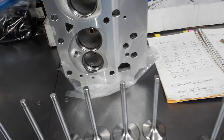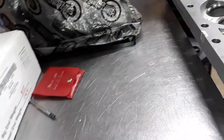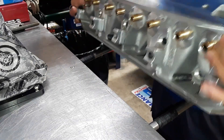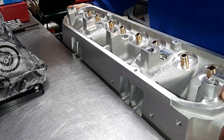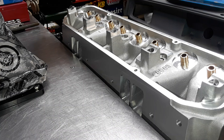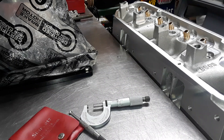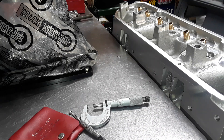The point is: double check everything, measure everything. You cannot assume anything on these engines or any of these parts. Buy yourself a decent micrometer that'll measure into the ten-thousandth range, and a small hole gauge, or have your machine shop do it — because without it you're just guessing. Don't buy into the nonsense about just taking them out of the box and bolting them on. That's a crap shoot, and valves have been known to hang up. Thanks for watching — bye now.